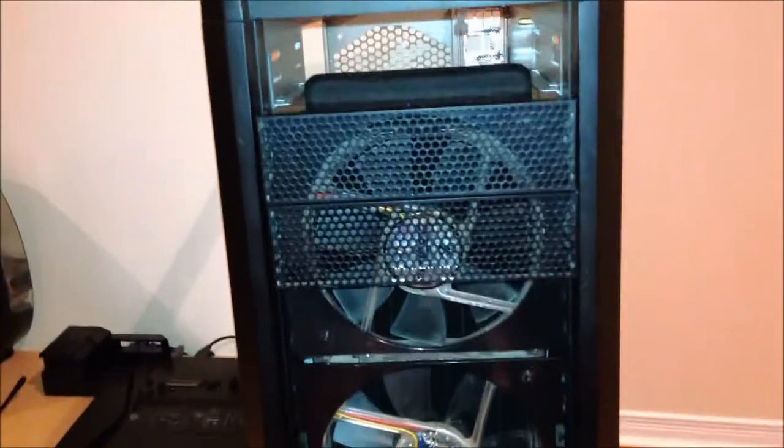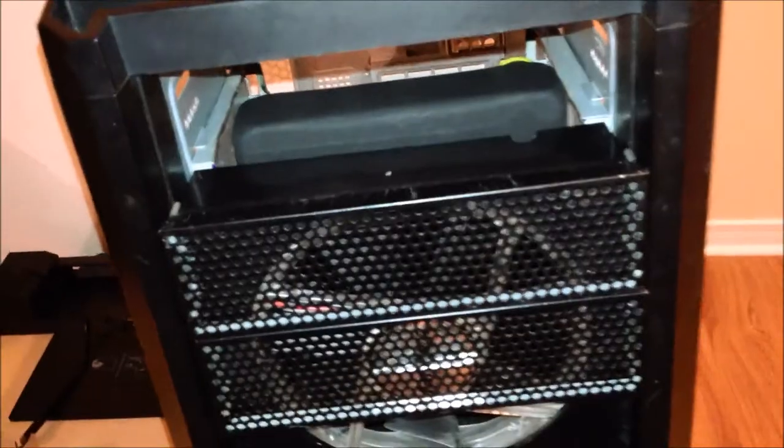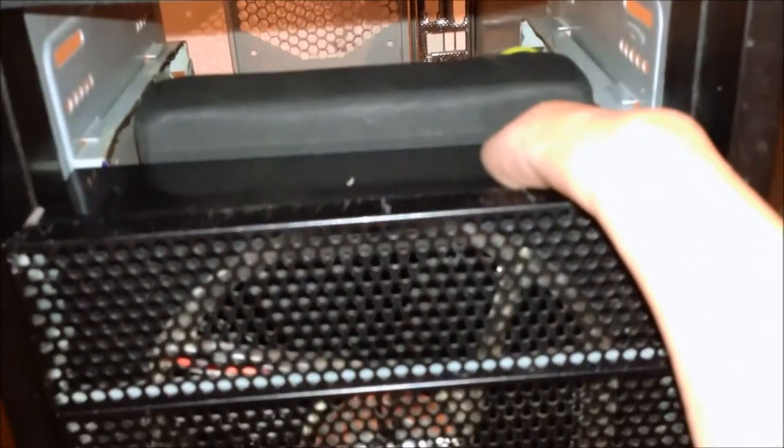The cutting is done — it took a lot of cutting and a lot of doing. This is just a temporary fix to see how it would fit. As you can see, the radiator's hanging there in the back and it's attached there in the back. What I had to do was cut out the sides of the hard drive bays, and then screw them in just the sides, because what fastens the fans to the front is the plastic piece here. So you screw them into there and screw the radiator to the back.